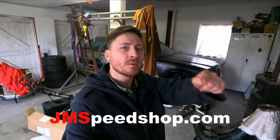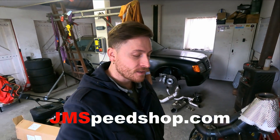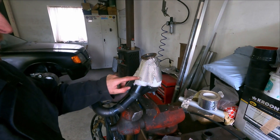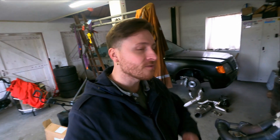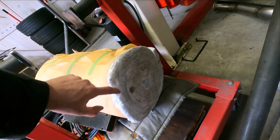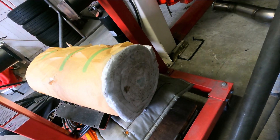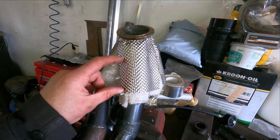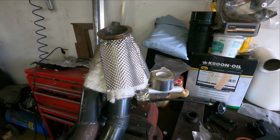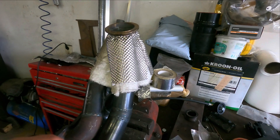If you have any questions about the heat insulation on your exhausts, put some comments below the video. I will try to put all the links on my website. The link also to one of these units that I'm using, and also to HJS. There are different sets you can buy - you can buy the stainless steel separate, the wool separate, or the set that I bought which is both of them. This is not the only way to do it - you can also use just ceramic wool, the same thing used in your chimney. The spec is up to 1200 or 1300 degrees before it falls apart. You also have different thicknesses of metal - not just 0.1mm but also 0.15mm options.